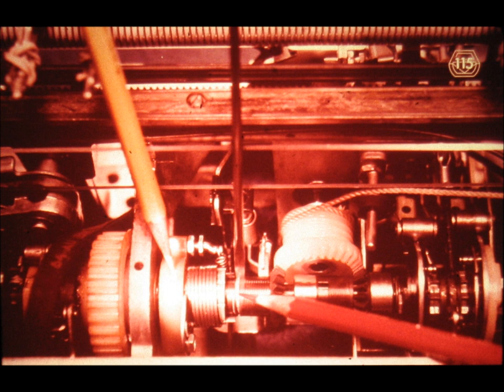Slide number 115. On level one torque limiter mechanisms, there is a second C-clip, or retainer ring, located on the operational shaft between the carrier return clutch driving arbor and the arbor of the carrier return pinion gear. To be able to see the point at which the two arbors come together, it is necessary to spread the coils of the carrier return clutch spring, as we have done here with the aid of a screwdriver. In order to get at the keeper, we must first loosen the set screws of the torque limiter, then move the torque limiter and the carrier return driving arbor towards the left. Only then will we be able to see and to get at the second C-clip on the operational shaft. If you happen to be working with one of these old machines, take out the C-clip at this point.